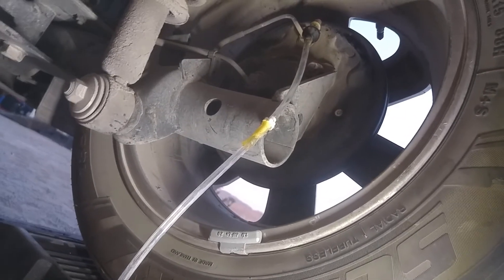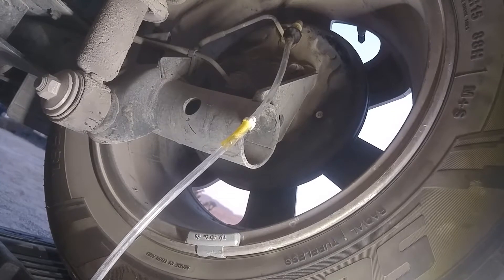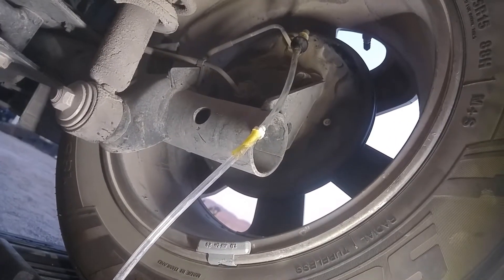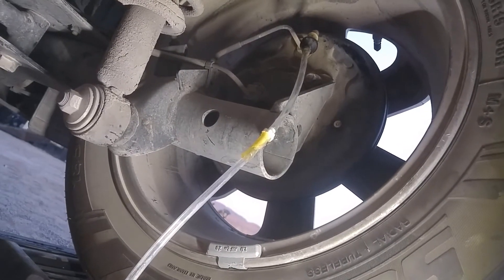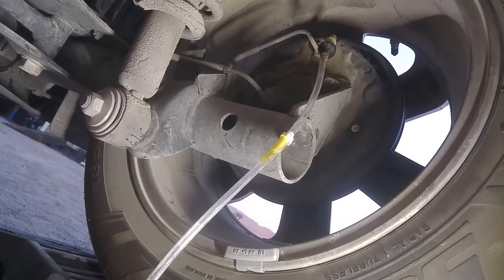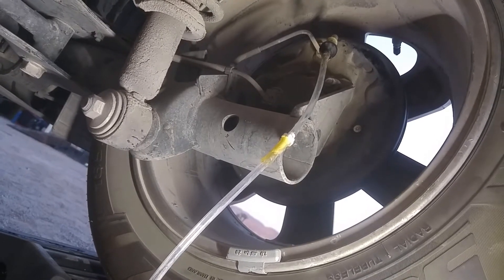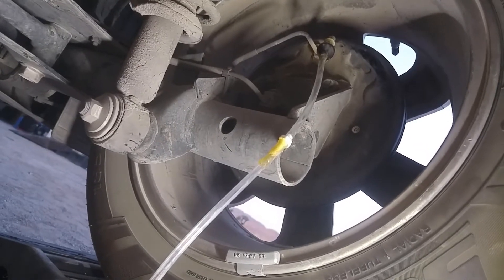But seemingly after you do that, the car behaves more normally for a while. In fact, at one point I had it work completely normal with almost no noise — normal accumulator running for about a week. And then it slowly started to malfunction again. So obviously, air is getting into the system somewhere and then pooling somewhere, and then when I do this rear brake bleed, it ends up being evacuated out. So that's my guess.